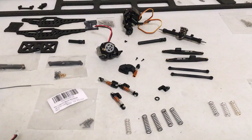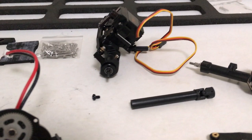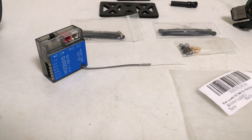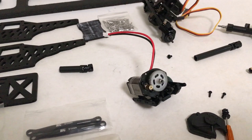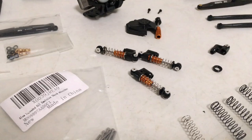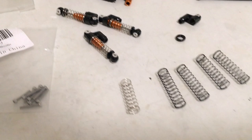A little bit of progress — completed the front axle, got the servo mounted using the forward-most position on the Best Servo Mount Ever, and the steering linkage is nice and in line. Got the transmission assembled, motor meshed up and broken in. I went ahead and unboxed my SCX24 and grabbed the V2 electronics out of it — done and ready to be assembled. I also grabbed some plastic drive shafts and these oil-emulsion shocks that look like Hot Racing knockoffs off Amazon.